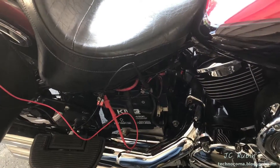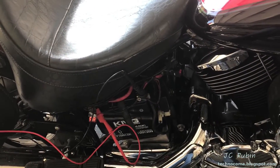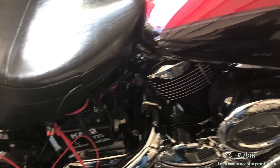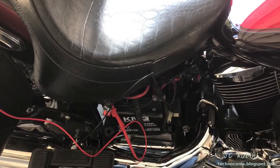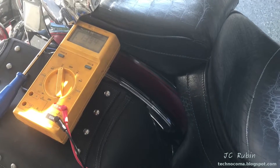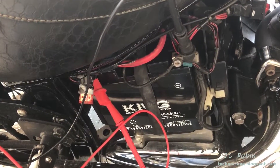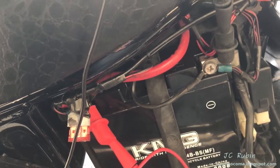There is another common issue: everything seems to work fine, but the next morning the bike is dead and battery voltage is dead. It's suspected maybe the battery is failing, or something within the system is leaking current. You need to check if there's a draw even when the bike is off. You have to be careful doing this - at bare minimum on a motorcycle you'll blow your meter. First thing: pull out that key. Why? Because if you pull out the key you can't accidentally turn the bike on.